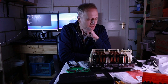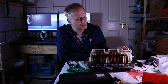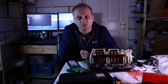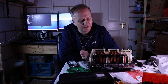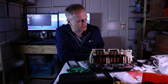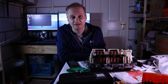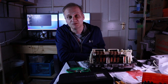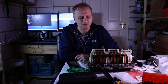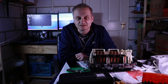So what I'm planning to do is swap the main processor board with a design by Damien Maguire. Damien developed an open source board that allows you to control the inverter. Johannes Hubner developed the software. What is also quite special about this one is that it has a DC to DC converter and a buck boost module that you can possibly use as a charger. So effectively, instead of one component, we get an inverter to drive the motor, a DC to DC converter and a buck boost.